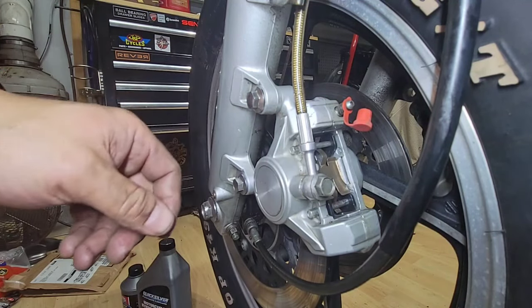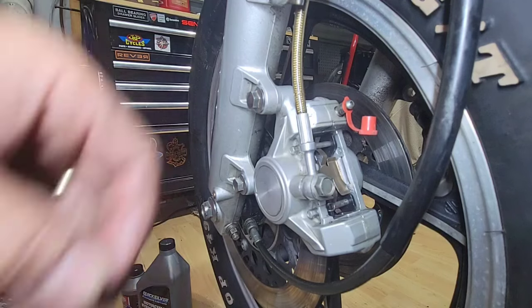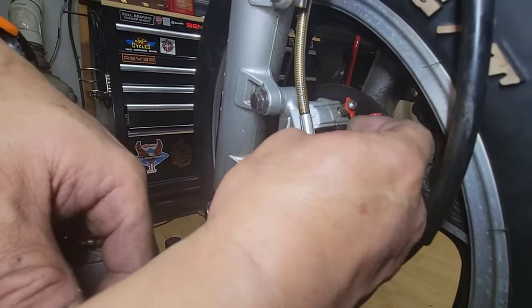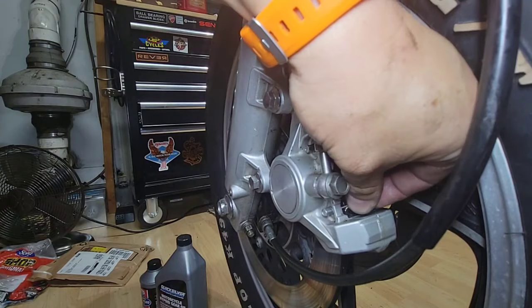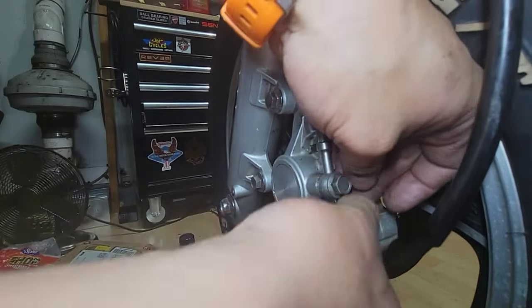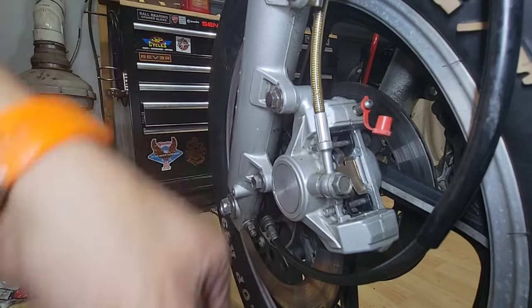What this is doing is just keeping the brake pads in position, and as you can see, they are. Now we have to make sure that we put the hairpins on it. I cannot see very well from where I am, so I will start rotating these ones. I think I see it. This one. Then I don't see the other one. I'm sorry for covering, but I just need to put this. Well, as you can see, I put it backwards. This has to go to the other side. The phone just makes it difficult. Now it's there. We can double check, making sure that it doesn't go out. That is the only work that it does.